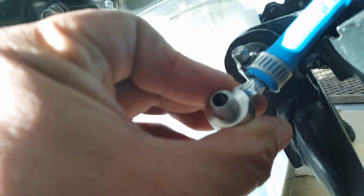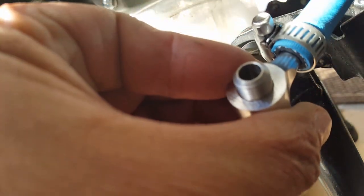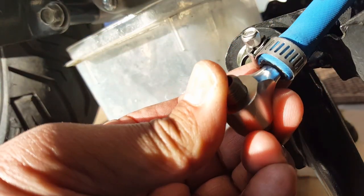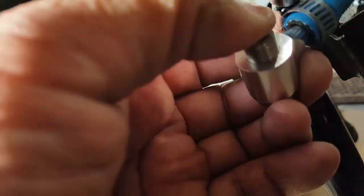I can still feel like it's bent on one side, but when I actually tug on the cable it lines itself perfectly without the cable being strained — that's what I'm going for. So this one is ready. What we're going to do is twist this guy off a little bit — loosen him, I mean — then spin him around so he lines up perfectly. Just a little bit of cable exposed, maybe a millimeter. This guy right here lines up right there, back to back. We're ready to tighten this guy down — I'm going to put some pressure on the bottom so it doesn't move and then drive it in with the socket.